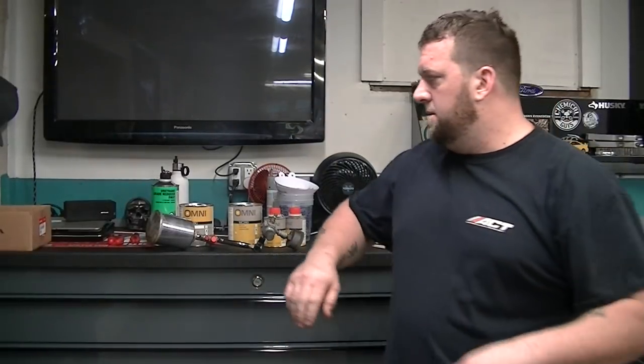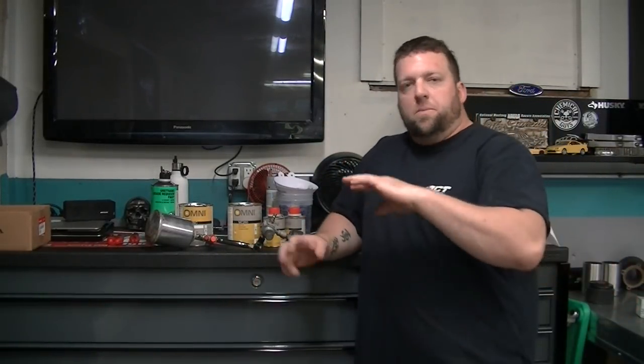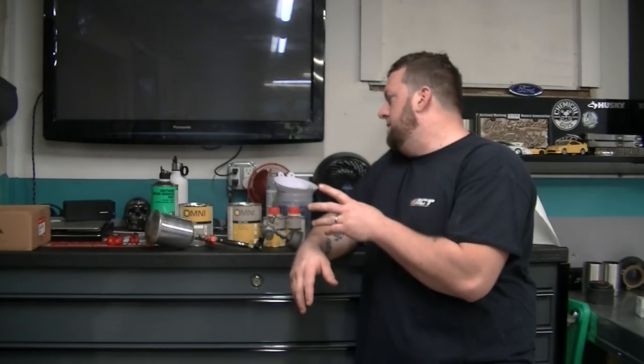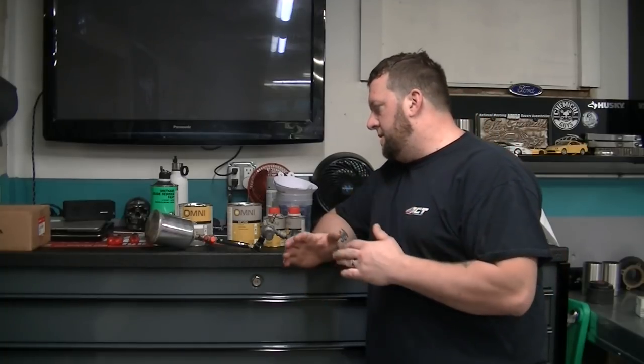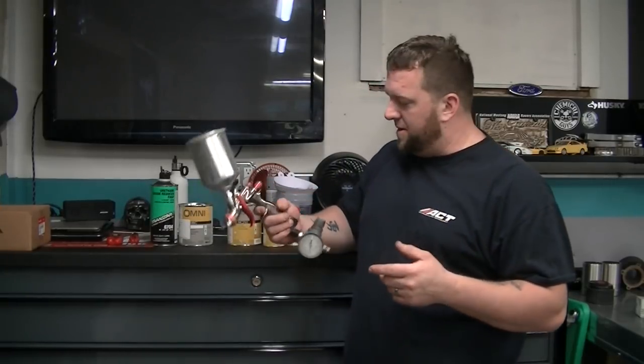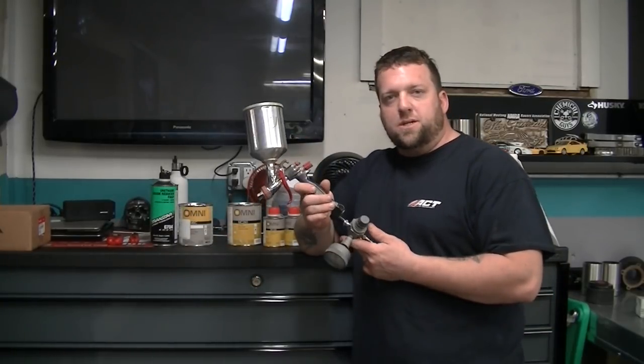Now that you have the rear end in full primer - two coats of primer, completely dried. I let mine dry overnight because I realized I didn't have any base coat reducer. Now I'm going to show you everything you need to do two-part base coat top coat painting. It's not a terribly expensive startup but it is going to cost you some money. First you need an air compressor - there's no way around that unless you have battery powered air guns. The second is you'll need a paint gun.